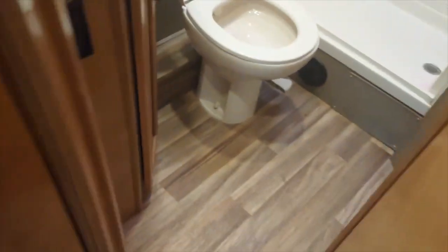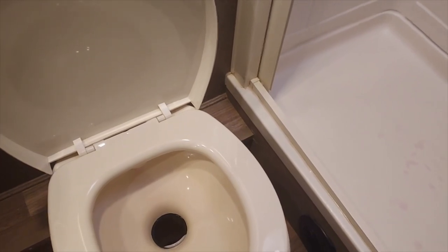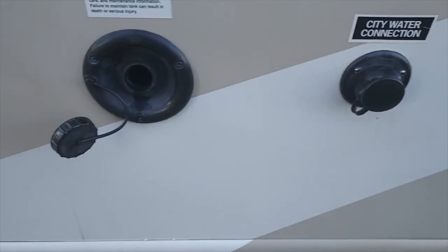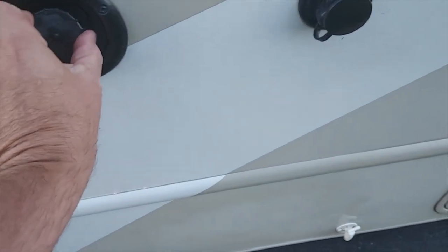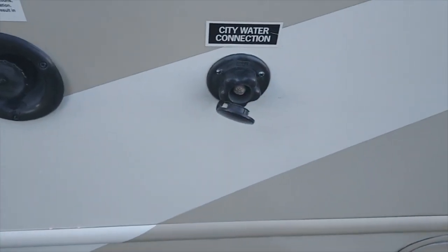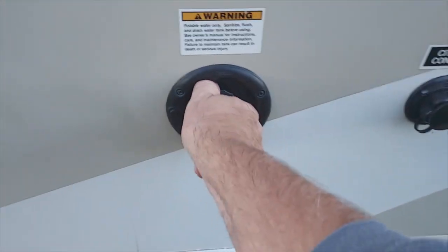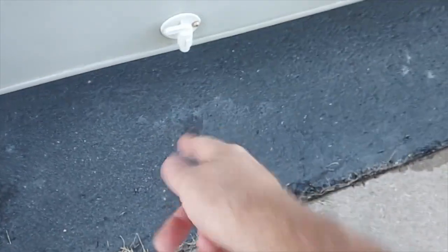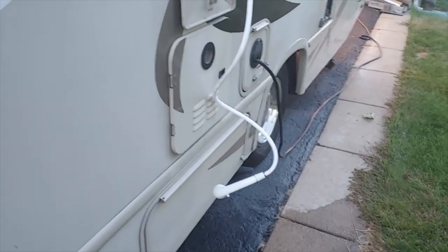Once your water pump's off, stuff will stop flushing. Let your water down here. We'll go outside and open the other one. Let's talk water heater — you don't want to forget, put your cap back on. So if you do your city water connection, put a hose on here with a funnel, or put the gallon and squeeze it, because there is a check valve in there most likely. Make sure your cap's back on. I open my tank valve — nothing dripped out because we pumped it all with the water pump. So we're going to put this hose away and then we'll show you the water heater.